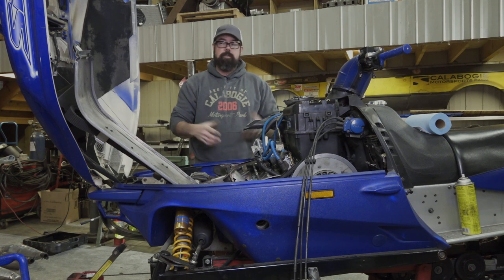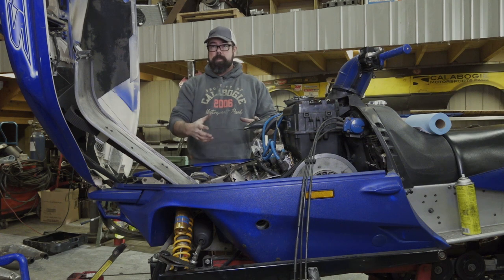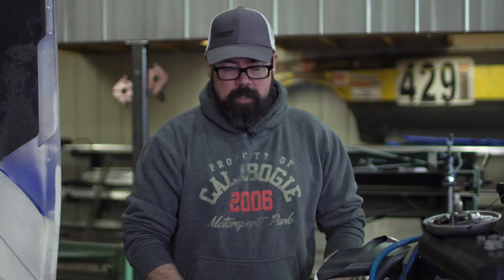At this point we've got everything cleaned up, the old pistons are exposed, the old rings are off, and we're ready for reassembly. For a sled with over 18,000 kilometers on it, I'm pretty impressed with the condition of the pistons and cylinders, so I am comfortable just installing the new rings. I wanted to show that this job could be done on a little more of a budget — we're not putting new pistons in — however, that would add about a hundred dollars per cylinder, almost doubling the cost for this job.